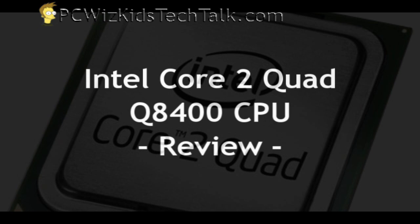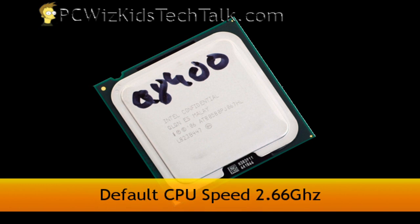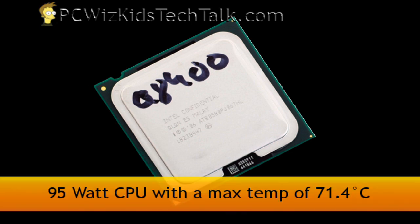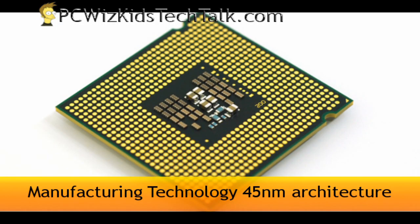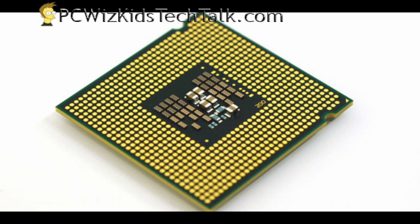This one here I've had the opportunity to review. It came out earlier this year, and it's a pretty good mainstream processor — 2.66 GHz with a multiplier of 6 to 8 and a default bus speed of 1333 MHz. It's a 95-watt CPU with good temperature tolerance. It's a 45 nanometer architecture, so it's going to use and dissipate less heat. You can see the max voltages it supports, and we're going to try to increase the voltage within those limits.